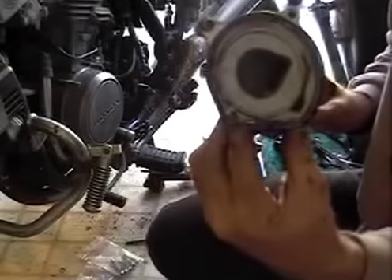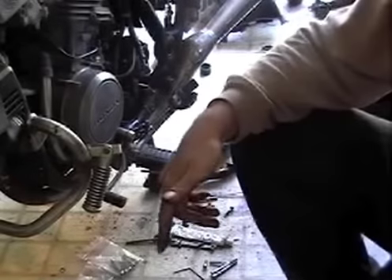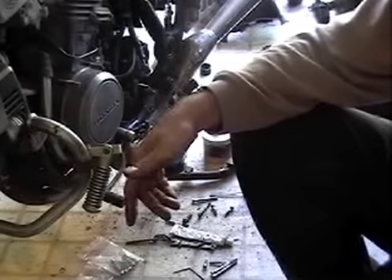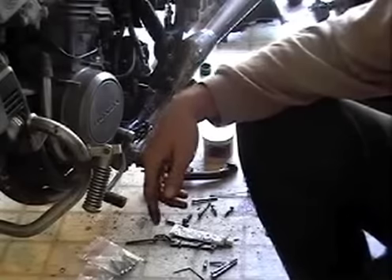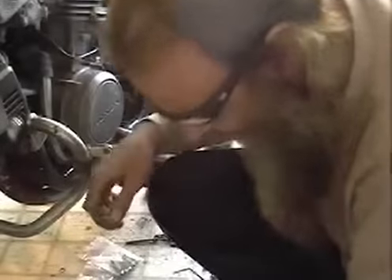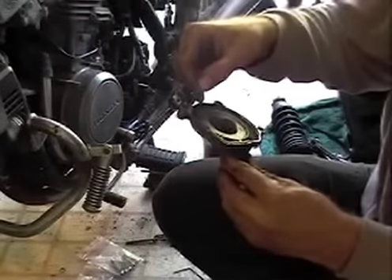That's all I do — just a little bit, just enough to hold that sucker in place. I'll let that cure for ten or fifteen minutes. Once that's cured up, I'll go on ahead and slip the rest of the water pump on. I've already got the first half in there. A lot of people do these Hondas with that stupid O-ring instead of a real gasket, and they'll pinch that O-ring and then I end up having to fix it for them.